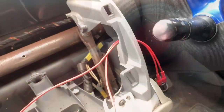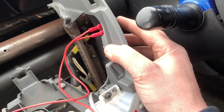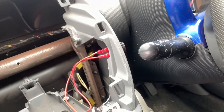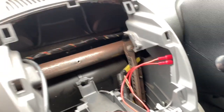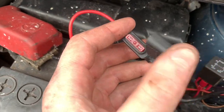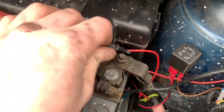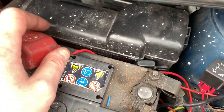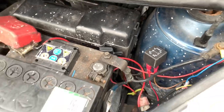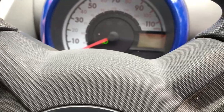The light doesn't stay on on the switch — I thought it had a light inside it, but it'll have to do. Let's put it back in and push it in. Turn that off. Now let's put our fuse in and see if it actually works or if it causes a massive fire. I'll just put a 10 amp fuse in — these are 18 watts each so 10 amp is probably more than enough, and if it shorts out it should blow before the fire gets out of hand. Lights on... and press — yes!